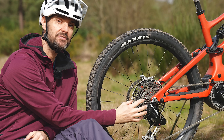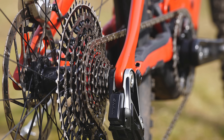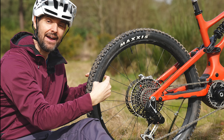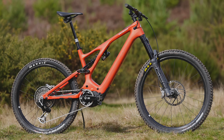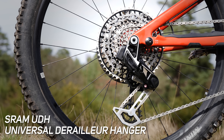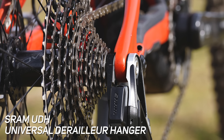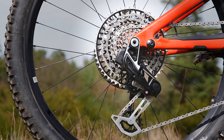These are on most bikes that have come out in the past few years. The way the derailleur mounts onto the frame is sandwiched in between the rear triangle — there's no longer a derailleur hanger. It's actually part of the rear axle, so it sits in between the rear triangle. Three years ago, the first frames appeared with SRAM's then-new universal derailleur hanger technology. This foundation allowed SRAM to prepare for the new transmission and this new direct mount mech. Now almost all frames have the UDH mounting standard.